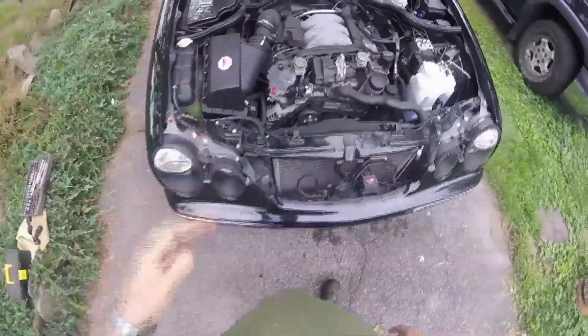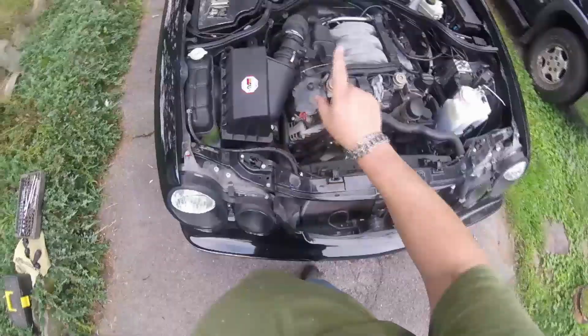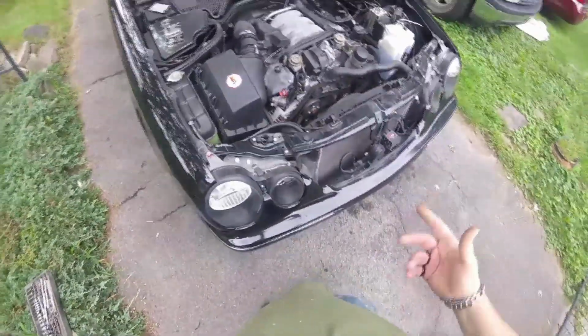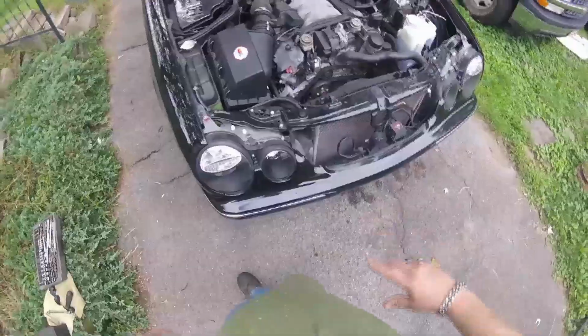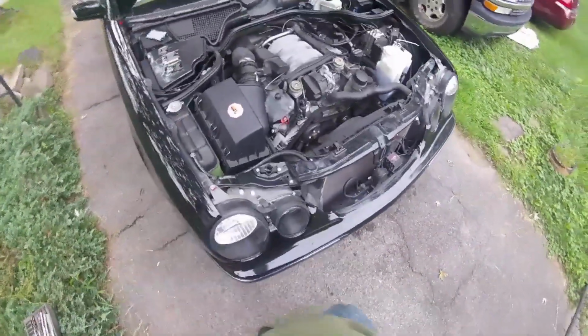Morning, YouTube family. Paul here. We're doing a 02 Mercedes E320. I was having excessive cranking on here. I did a fuel pressure test on the Schrader valve here and found that my pressure was jumping up to about 40 pounds and then dropping right back to 10. As soon as the engine starts, I run it, shut it off, it drops to 10 and then to 0. I believe I have leaky fuel injectors.